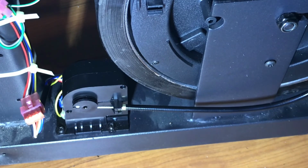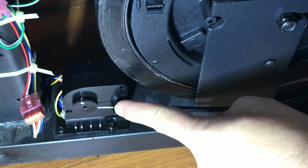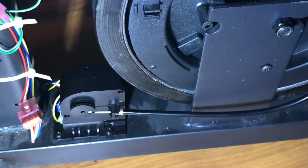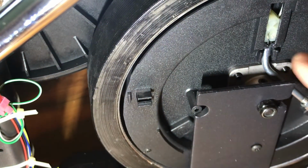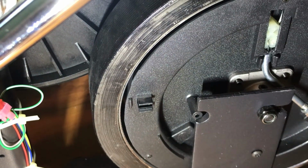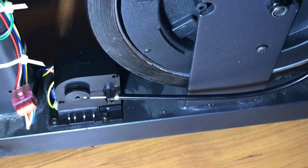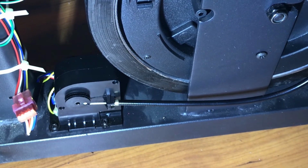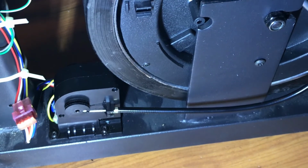And now if we turn down the resistance, you can see it's now pulling this cable around and therefore pulling that magnet away from the flywheel so that there's less resistance. And again, we can verify that here. And looks good. Motor sounds great. Was able to change resistance up and down without any additional help. So let's put this thing back together.